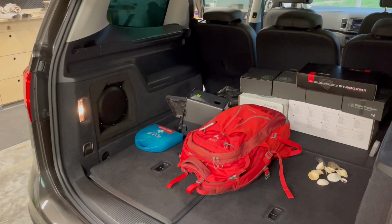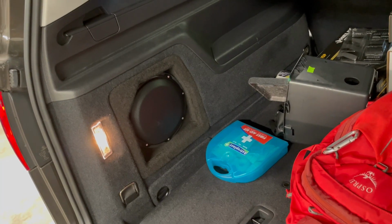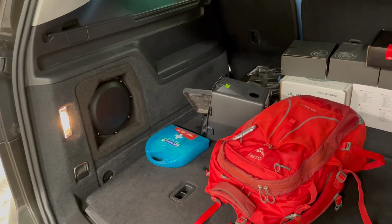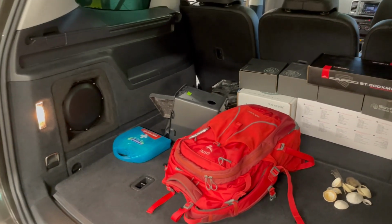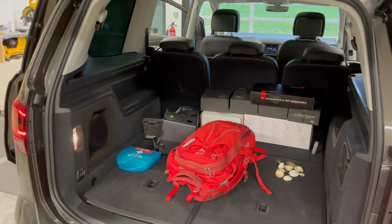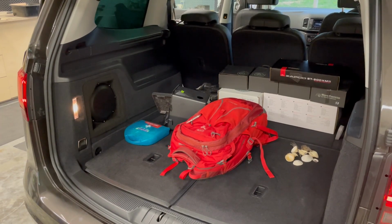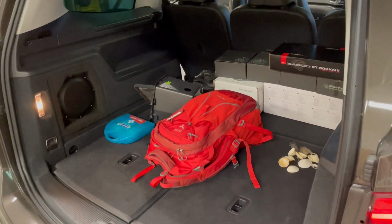And I thought this wouldn't play much bass, but we were like, let's see. And actually, that JL W3, yeah, we had response from 35 hertz, so it's not bad. And between 40 and 80 hertz, it's absolutely solid in the car. It has decent output, so it's quite surprising and remarkable. What it's like in terms of sound quality, that's a different story. However, it's not bad, is it? It integrates pretty well. We don't have big phase problems in the cabin, even if it's a huge and long cabin. Normally in long cabins you would have problems up front with the sub at the back at around 60 hertz or so. But it plays pretty well, and from such a small box, it just opened up the world to me what you can do with these subs. It doesn't mean I want to build tiny little sealed boxes, but it's actually working.